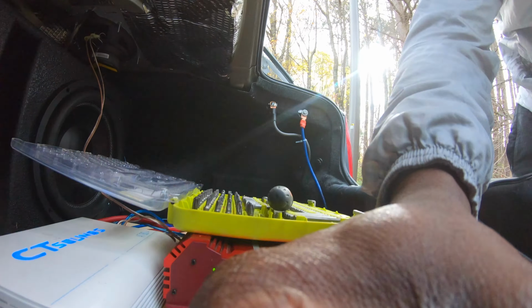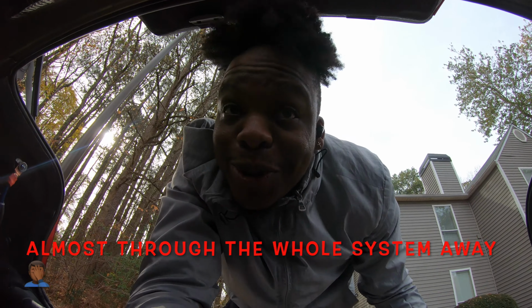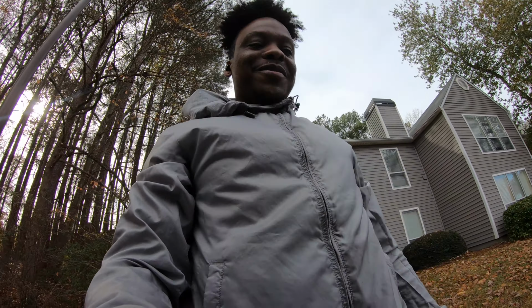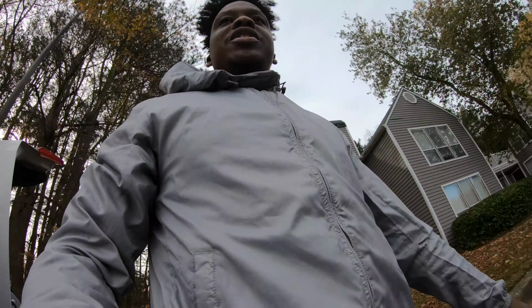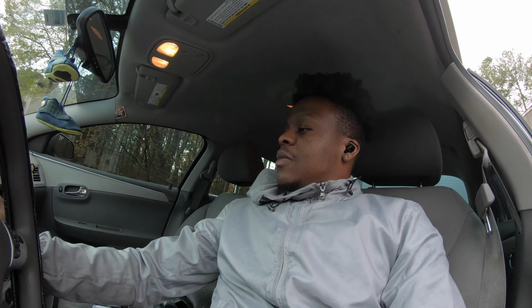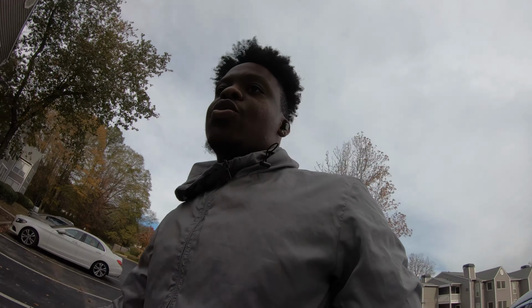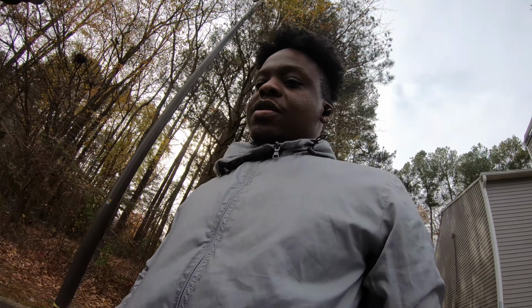RCAs is no good. And I was right here doubting these little Lasers 400 taking 15. But I tuned it myself. It's pretty simple. The best way to do that is to just listen for that hum. Once that hum changes sound, that means you clip it. What you gotta do is back off about like 2-3 notches, and then boom, all good. You don't need to go pay somebody like $50 to $100 to tune it for you.